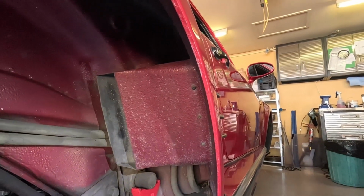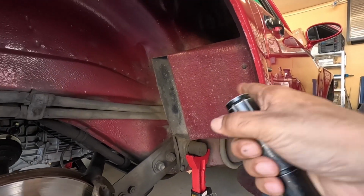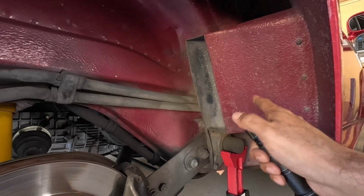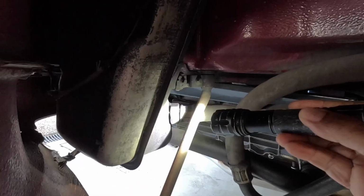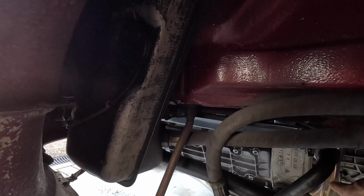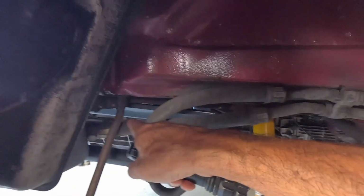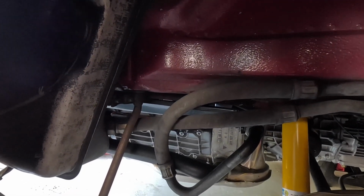Now, while the oil is sort of cold, it actually doesn't go anywhere. It just goes straight back. It hits the thermostat, it's closed, so it goes straight back through this other line into the bottom of the tank here, gets forced up through the oil filter and then drops back to the tank. So it just does that circuit. It goes through the rubber hose, through to the engine, comes back out of the engine, up through this hose to the thermostat and then back. So it just runs that loop while the engine oil is below operating temperature.